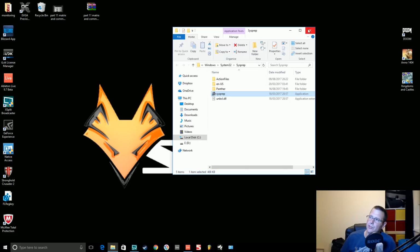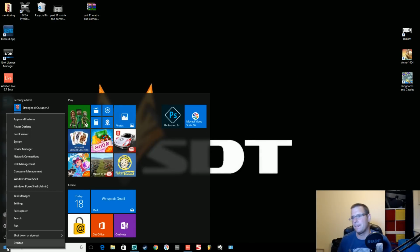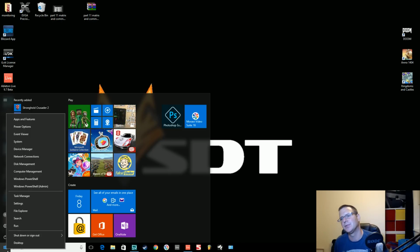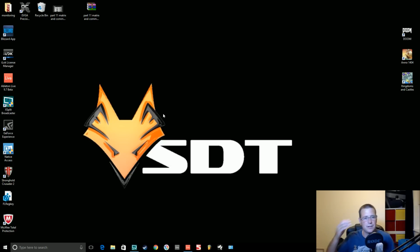I have done this twice now, and strangely what it did on the reboot is it took me to the screen where you create your desktop user. It took me to a screen where you have to create a new desktop user, so I had to create a new name. You know, where you log in at the start, you turn your computer on, your username comes up and you put your password in. It runs you through the process of generating that. It asks you if you're English, which I am, which keyboard layout you want, which password you want. You re-enter your password, and then it brings you back into Windows 10, everything hunky-dory. But then you've got your original username plus the new one you've created. That's not a problem.